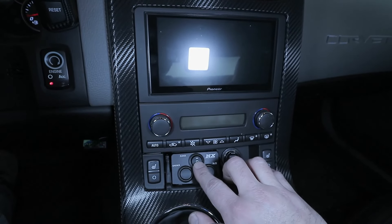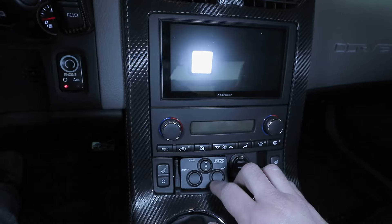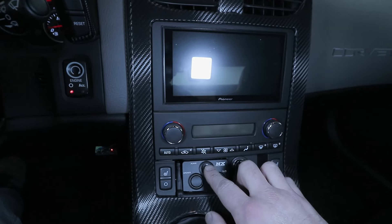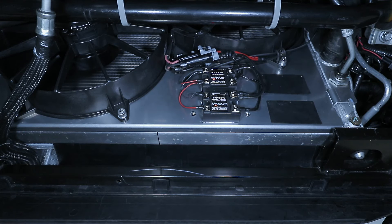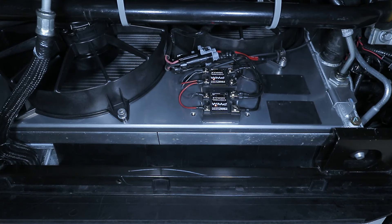Real quick, I want to mention the operation of these flaps. You have two rubber flaps at the bottom with cutouts and windows. At low speed, these get suctioned shut. At high speed — around 80 miles per hour and above — the shroud actually becomes a restriction because there's so much surface area being blocked. So these flaps open up to pass air through, reducing restriction top and bottom. That's why you see them louvered and flapped — it opens up the shroud for less resistance as you pick up speed. It's a really well-thought-out, well-designed unit.